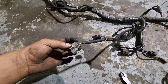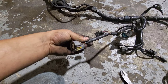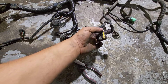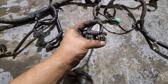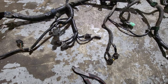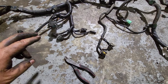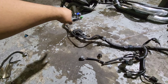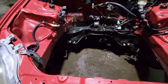This one here is the throttle position sensor. And this one is the MAP sensor — MAP sensor and intake temperature sensor. Then we have the idle air control valve, but this one's a three-wire and I have to convert it into a two-wire. It's very simple — just get a normal two-plug, add it here, discard the orange one, and switch one wire over to that plug. Everything else should be the same. I gotta go find the stock mount off of that EK parts car and put it back in there.